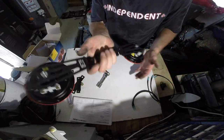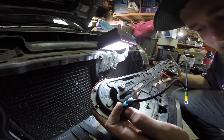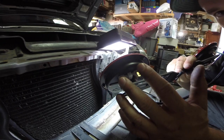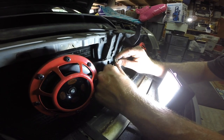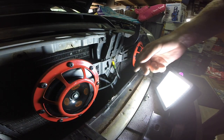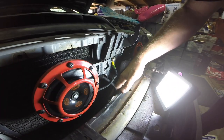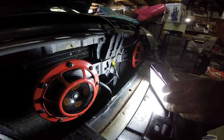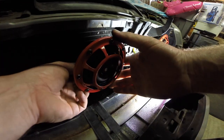The Hella horns are mounted to the bracket. Let's go ahead and see how it fits on the car. I took the wiring harness from GrimSpeed and hooked up the negatives — doesn't matter which prong you put the negative on, just make sure it's one of those prongs. Let's try to mount the ground wire right about here. Got our ground situated; now we've got to run our factory horn wires to the back of the Hella horns and hopefully we have some horn action going on.